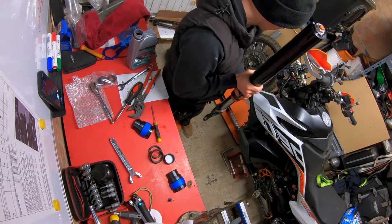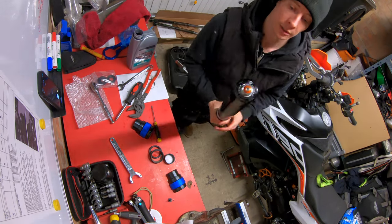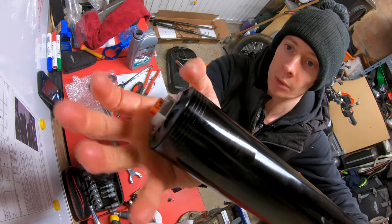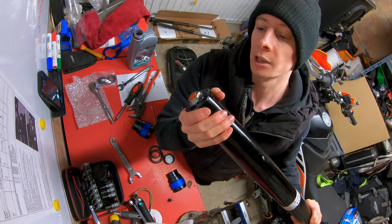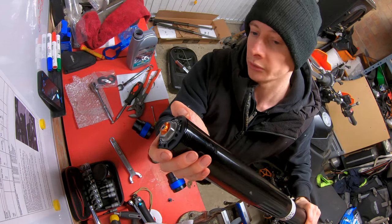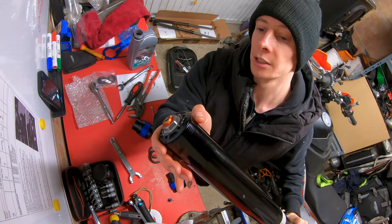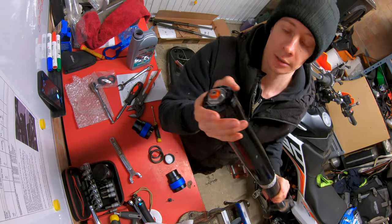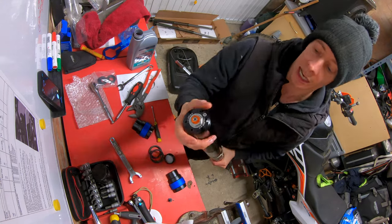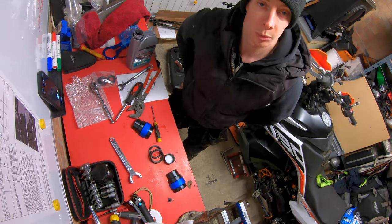I'm not going to slide this in just yet because I want to do some bits on the front of the bike. You've got marks on the top of the forks — before you take them out, work out which mark it's sitting in. The standard, from comparing mine and my cousin's bike, is you've only got one of those lines showing. So the top of the triple is sitting in line with the second line — you have an equal gap, one line, equal gap, and then the seam between the cap and the fork. Take pictures before you take it apart and you'll know what's going on.